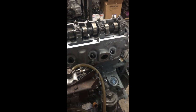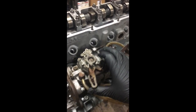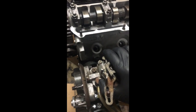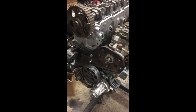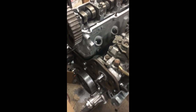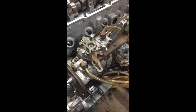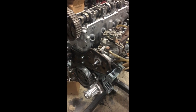That's going to conclude today's video. Our cylinder head is torqued and our injection pump is loosely mounted to the bracket — we want to leave it that way for timing. The next video will cover timing the belt and the static injection timing, so stay tuned.